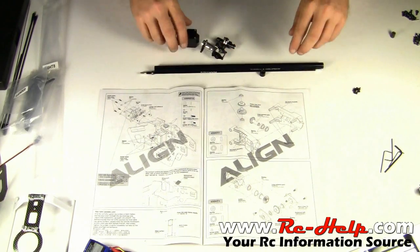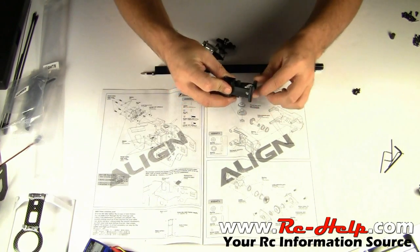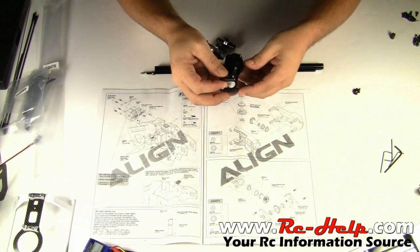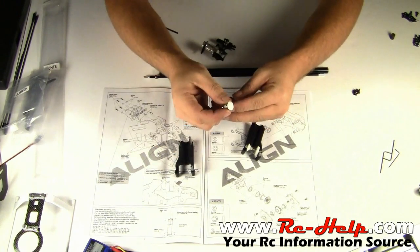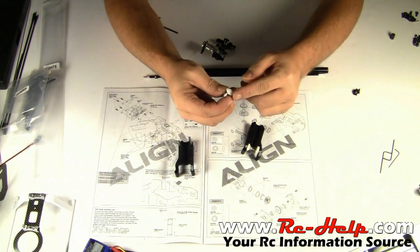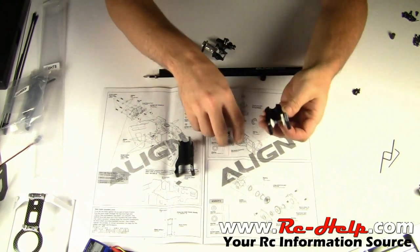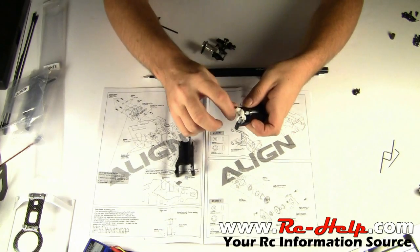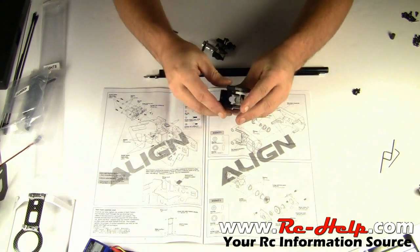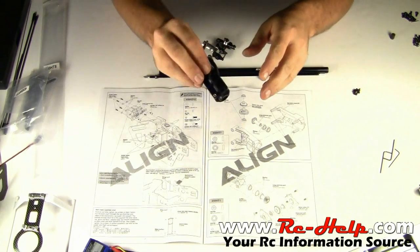There's more screws. We've got all of our stuff set out and there's not really much that we need to do on this front block. Make sure your bearings are nice and smooth — take it apart, make sure there's no gunk inside. The first thing you want to do is inspect these umbrella gears, make sure the bearings are rolling free, make sure there's no teeth missing. Everything seems to look really well in this one. Because this is a torque tube and not a belt, there's no threadlock on this front block here.